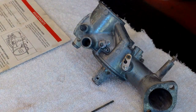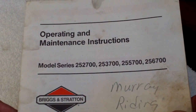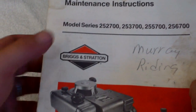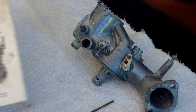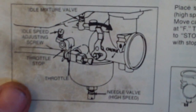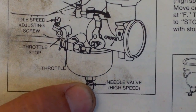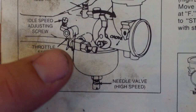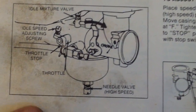Got it cleaned out and everything separated. I wanted to show you where I'm getting this information from — this is operating and maintenance instructions from Briggs and Stratton for these model numbers, but it had these one-piece carburetors on them. These were the flatheads that came with them. And this is what we are dealing with here. We get to where you can kind of see that is a schematic of it — that is going to be your high speed adjustment, and right there is going to be your low speed adjustment.